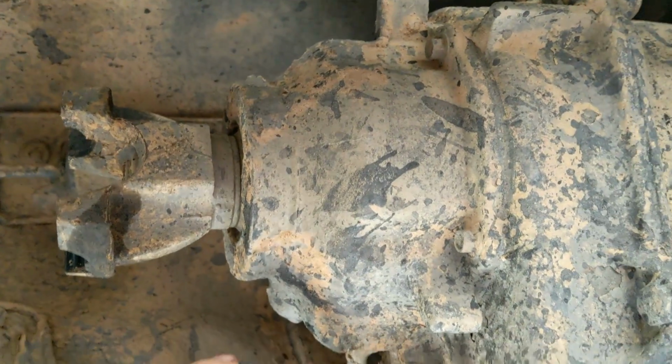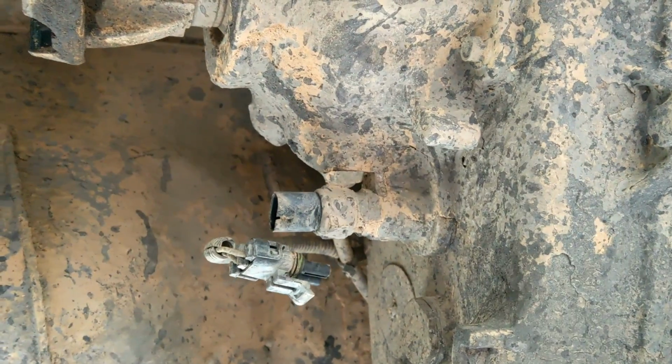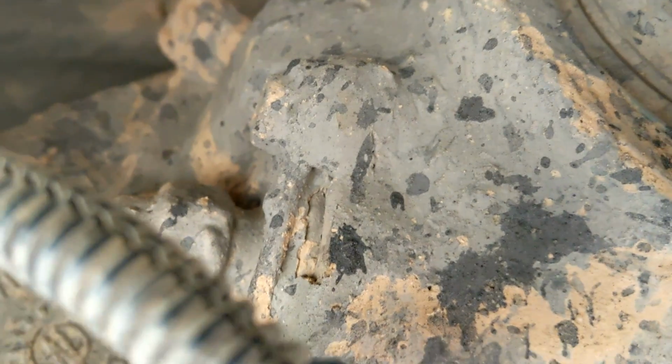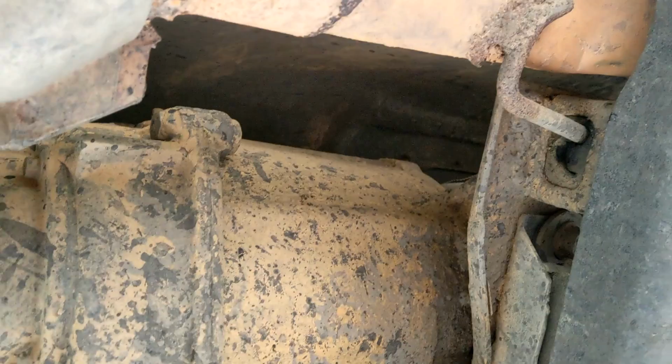So, alright, sensor. The older ones are going to have a vacuum line, the newer ones have an electric. I switched mine to an electric switch just because fuck vacuum. That's just your 4-wheel drive light. The other thing is going to be your speedometer sensor. That one's got that little C-clip thing there. You take the one bolt off, and I think you take that nut off as well. Actually, no. We can just remove the speedometer cable. We don't have to do the clip and the gear and all that crap. That can stay for now. It'll probably have to come out later anyway, but whatever.